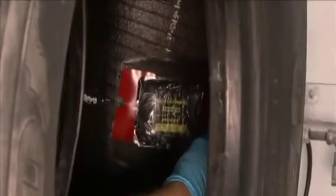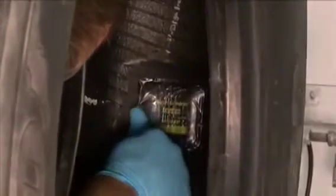Now stitch the repair unit down from the center outward. This process removes any air which might be trapped between the repair unit and the inner liner of the tire. Exert firm pressure on the stitcher to maximize adhesion. Remove the red poly. Thumb and stitch the edges. Then repeat stitching in the opposite direction. Make sure to remove the clear protective covering from the repair.